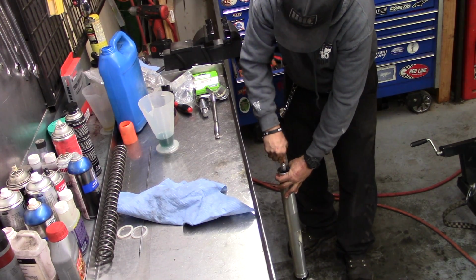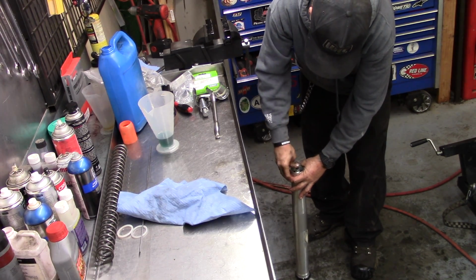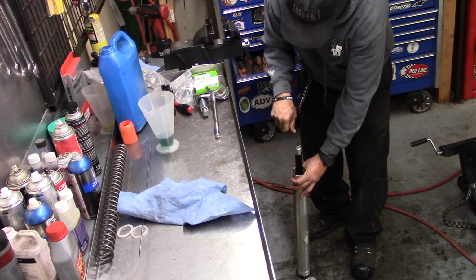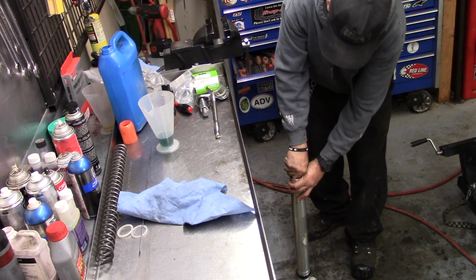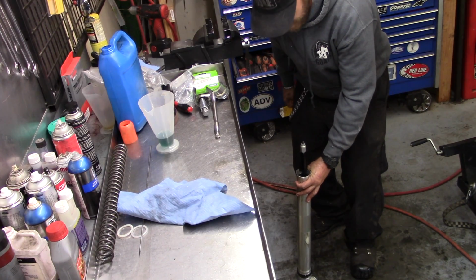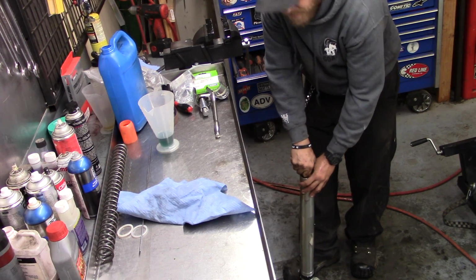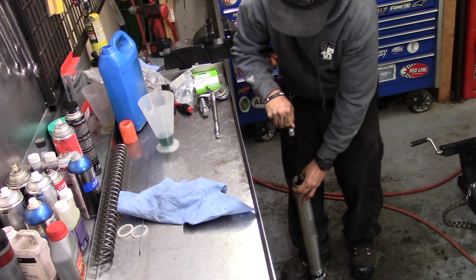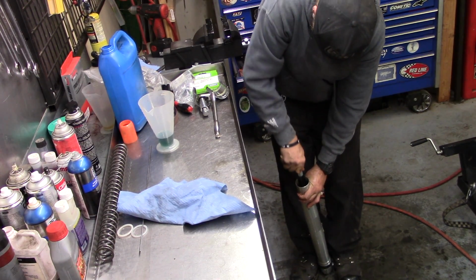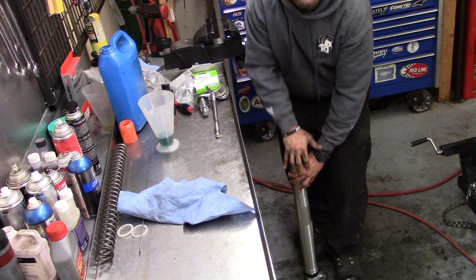even more. And see, now it's coming up all by itself. So you can actually do this whole process from the top. It just takes a lot longer. As you're bleeding it, you know it's getting good when you push it down, and then here it comes back up. So we're getting close. And it helps, when you're bleeding it, to kind of move it away, push down, and pull back. You don't have to come all the way up all by itself, so we're not quite there.